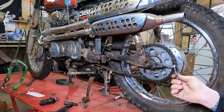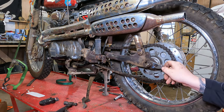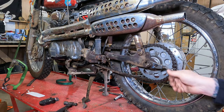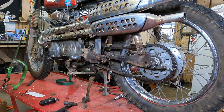So now we're going to loosen our jam nuts — on this bike it takes a 10-millimeter wrench. Make sure your axle is loose. Now, a lot of people are going to bring up the little hash marks on the swing arm. You can't really see them because of the dirt and rust on this bike. You can use those and count — this side's three hash marks in, other side's three hash marks in. I had a '96 Suzuki Bandit and those were wrong. So you can use them, but I don't recommend it.